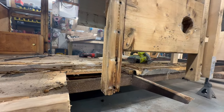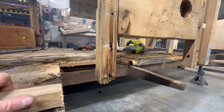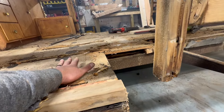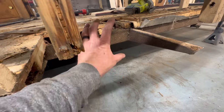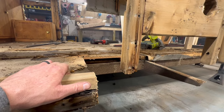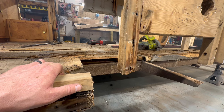That way I can run new 2x4 joists all the way across, right to exactly where I need my fender opening to be. I've done my measurements. We're going to be able to build this with a flat floor because of my 255 tires. I'll have to create a fender opening, but it'll be within the frame rail section. So I've got some sheet metal I think I can do that with. Build some spray blockers essentially.